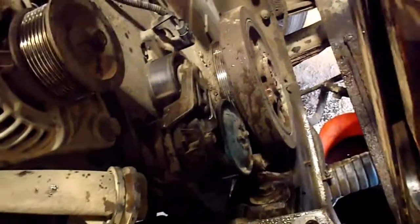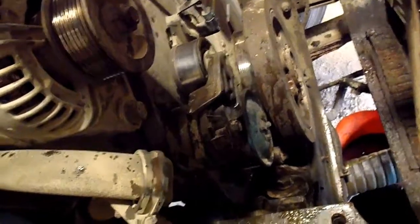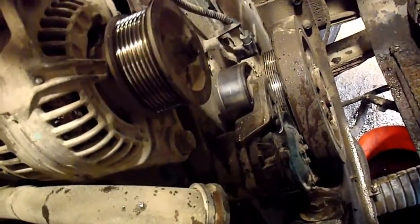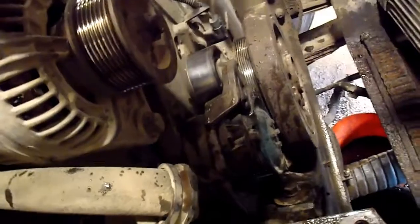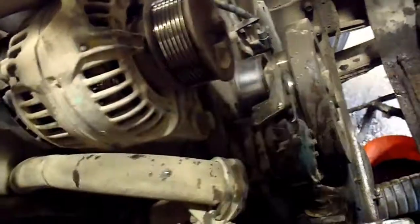You've got the water pump, and there's only the one tensioner on this truck that has a bearing in it. But when I see fan belts, you saw what the belt looked like. See, there's a tensioner for the AC as well. It's not in too bad a shape. When you see the belts getting shredded though and pieces coming off of them, this belt was pretty old and crusty anyways, but when you see the ribs starting to come off, there's a piece of it there.